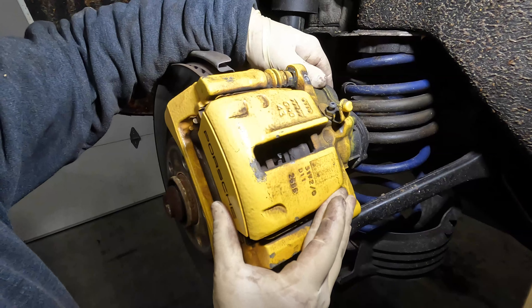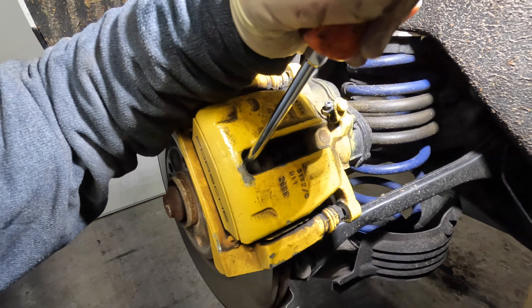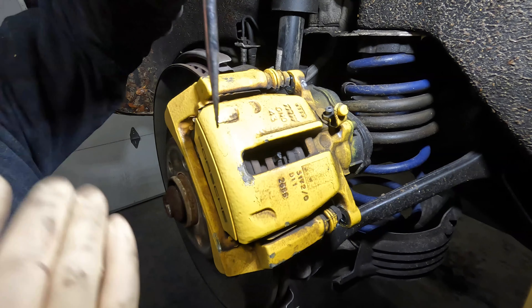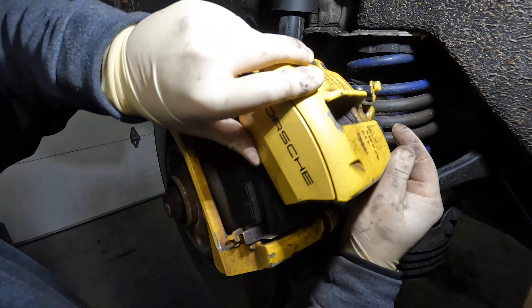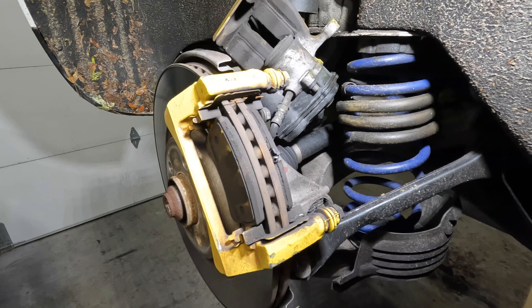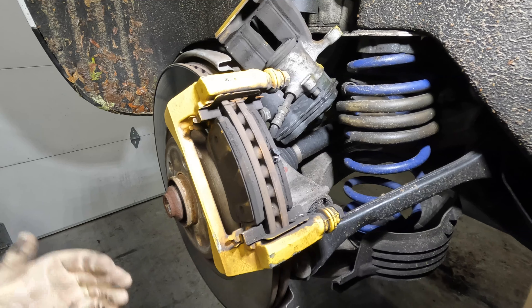Now that we have both bolts off, you can see the caliper is pretty loose. This is where it's easy if you guys put everything into service mode — this caliper will act just like a regular caliper. I'm going to take my screwdriver and push it back here, and you will see it moves like butter. It literally has nothing keeping it from going back into place. If you don't put them into service mode, you're not going to be able to do it this way and it takes a lot longer. Having the right tool for the job is a big thing here. I know a lot of you might say you don't have a $2,000 or $3,000 scan tool — there are other ways — but we used a computer in this scenario and you saw how easy it was.